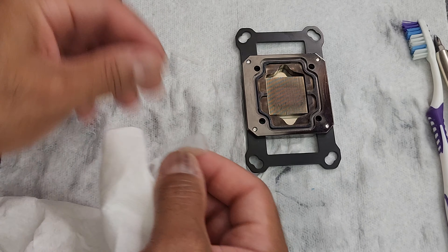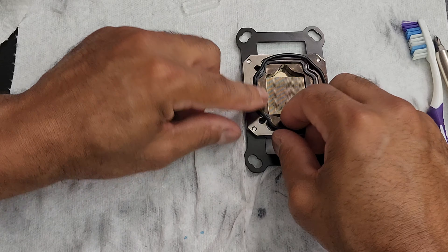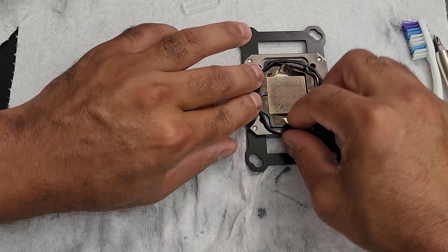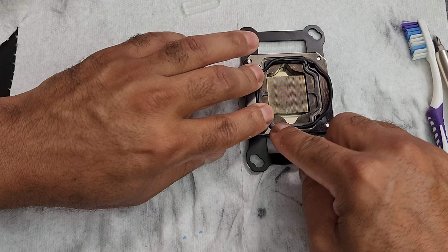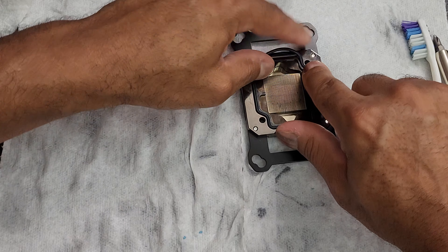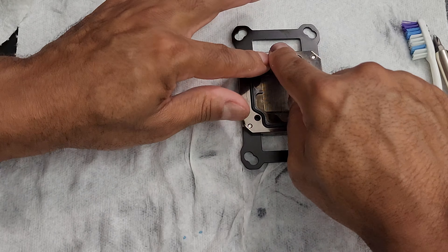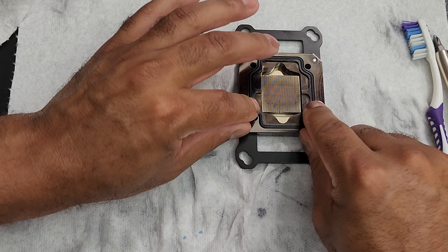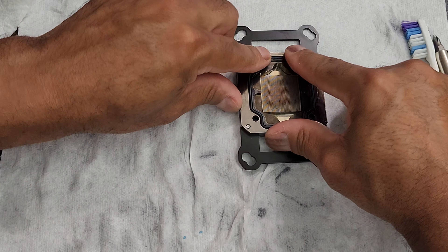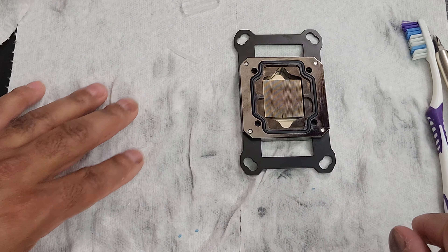Let's figure out how to put these back together. These o-rings are always interesting because you have to get them in the right place - you can't just be willy-nilly with them. They've kind of been trained to be a certain way on a water block over time, especially with all the heat changes from your PC turning on and off, going on full load, then being cold again. So you want to make sure you're putting it in the exact same way and give it a nice rub down to make sure there are no kinks forming. Even out any slack so it's nice and flush.